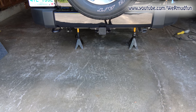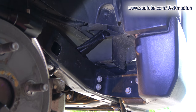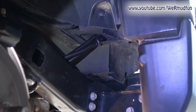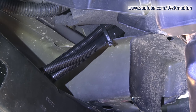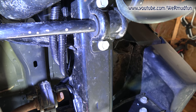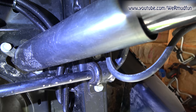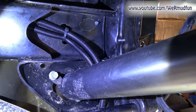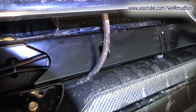You do not need to jack up the Jeep or take the tires off — we did that strictly to make it easier to show where we're running the wires. Coming out from the driver's side taillight, you see those three black wire looms coming down. One goes off to our trailer hitch, one goes over to the passenger side to hook into the passenger taillight, and the third will make its way to the front of the Jeep. We brought them to the inside of the frame on the driver's side, wrapped them around the shock, and fished both through a channel Jeep provided over to the passenger side.